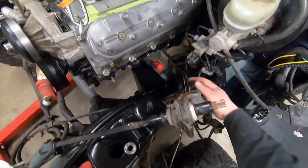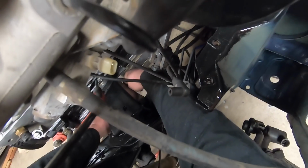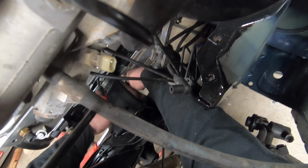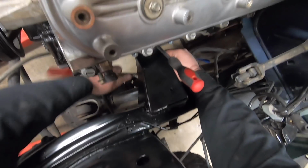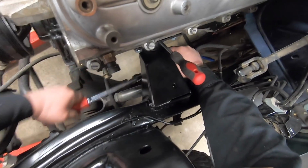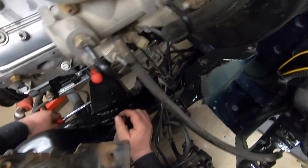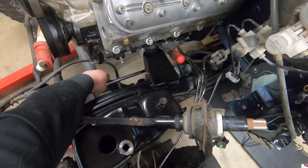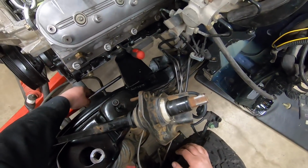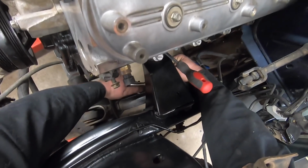So once you got everything into place, there's enough room between the motor mount and the bolt that you can jab a screwdriver in there, so you can start to tighten this up now. And these stovers like to go on pretty tight. So that's what I was saying before, like maybe other LS engines are designed differently, but I think trying to get this bolted up afterwards and tightened down would be a little bit of a pain in the butt. But that's why I'm doing it the way I am.